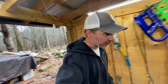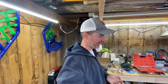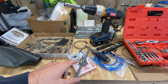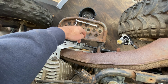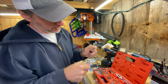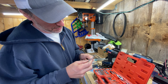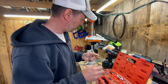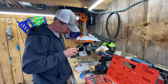One thing I've been learning as we work through here — as I'm working on getting that pull start case on — is that the quad is a mix of standard and metric bolts, so you've got to be careful. I'm over here cleaning threads on some of these bolts. The ones that hold the pull start assembly on are metric. These came out of the tumbler all cleaned up; they still have some media stuck in the washers. I like putting dry bolts through because the cleanup is a lot easier — if I do wet media in the tumbler I get paste all through here.